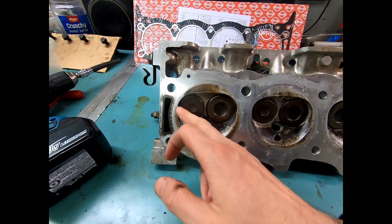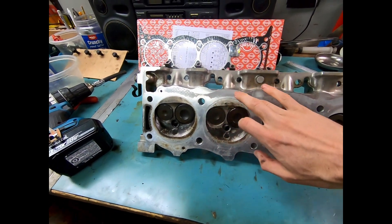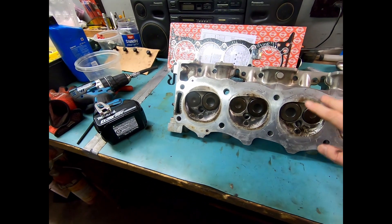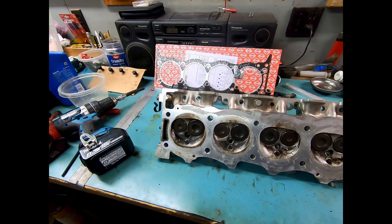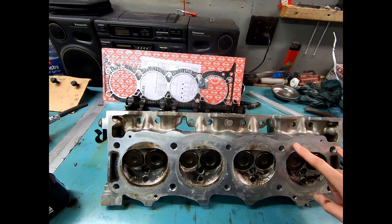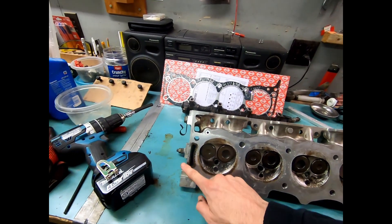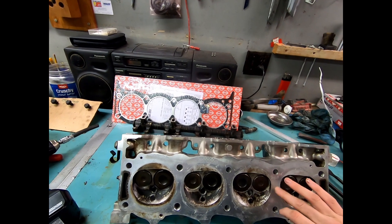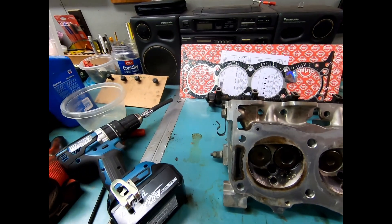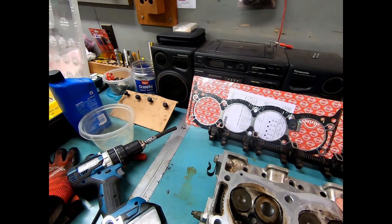There's a good film of oil on all the aluminum everywhere and some oil came through the passages — you don't want a lot but some is good to see. I'm going to brake-clean the surface. I checked it for trueness using a 24-inch machine straight edge, which I keep in a climate-controlled area. I trued it up by going diagonal, straight across the head bolts, checking from all different angles.